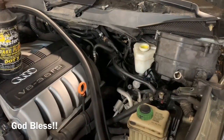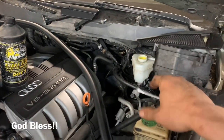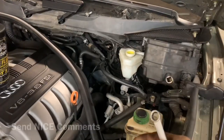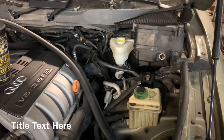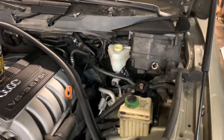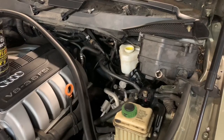The first thing we're going to do before we add the fluid is open up the lines and leave them very loose. What we want is for the fluid to drip out the lines when we add it. Once we've added the fluid and it's dripping out both lines, we're going to need an assistant to help us bleed out the master cylinder. Now, before you say they come with lines and you bleed them on the bench — yeah, that's true, they do — but I'm going to show you how to do it on the car.